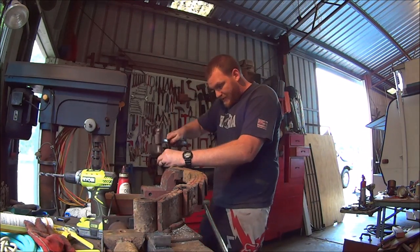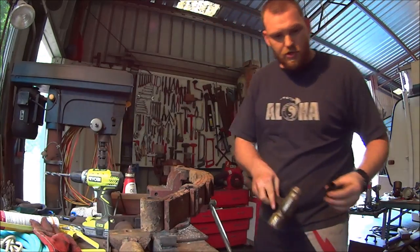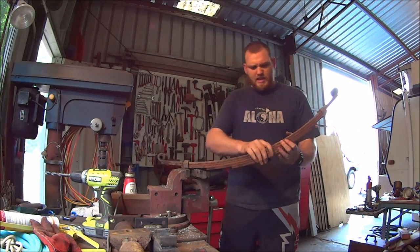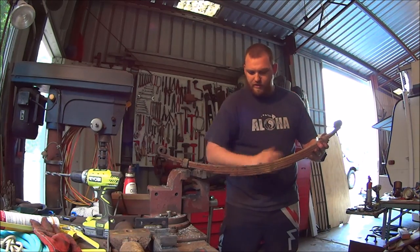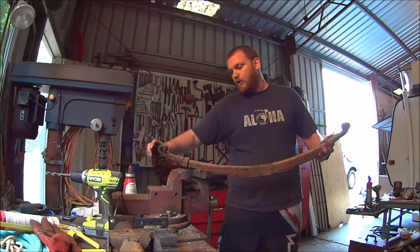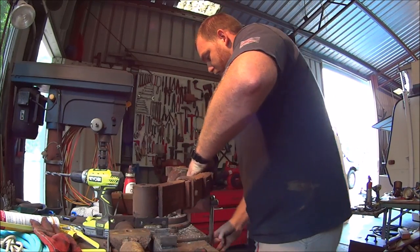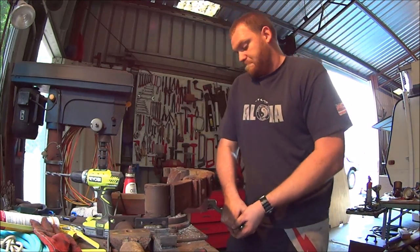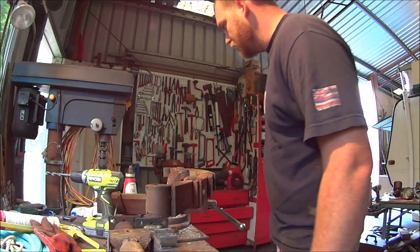The reason I'm reusing these spring packs is because they don't actually make this size — they'd have to be custom made. The reason I know they're okay to use is because these little clamps are still tight, nothing's splaying out, the locator's still intact, the eyes where they mount to the chassis rail haven't opened up, nothing's damaged or cracked, and they rode fairly well. The leaves are in. All this surface rust is nothing to worry about — I'll give it a wire wheel and a lick of chassis paint or rust kill underneath the van anyway.